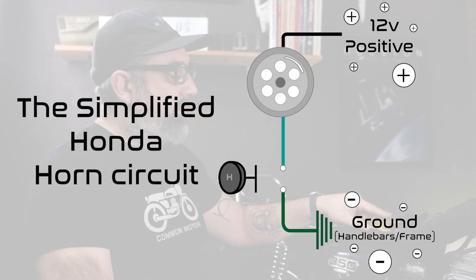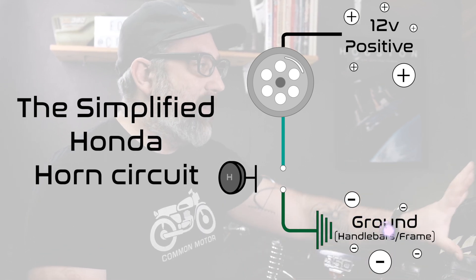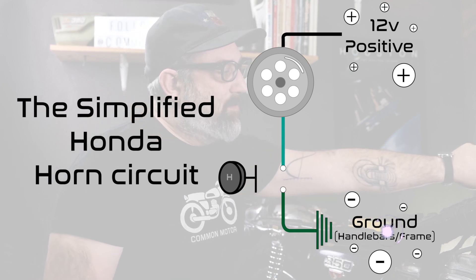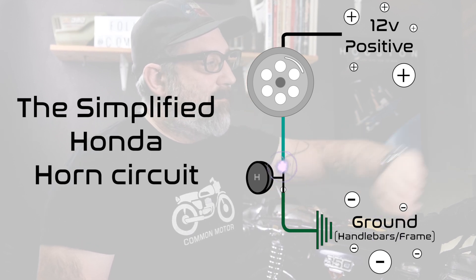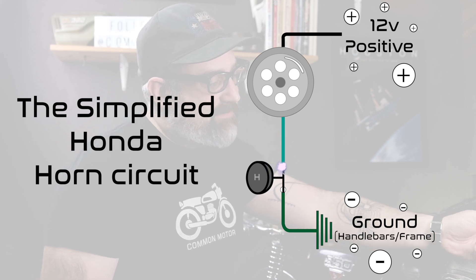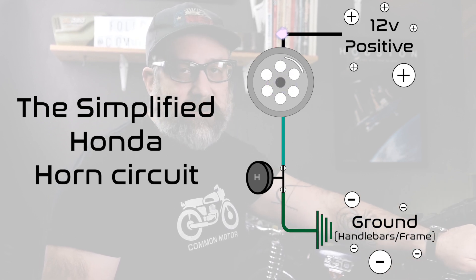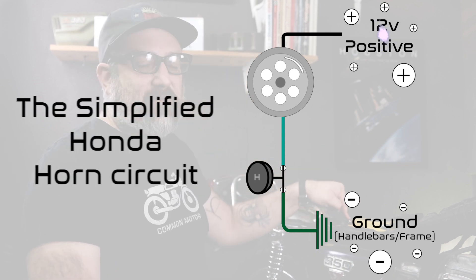So this is going to be the circuit for the horn going off with our charged battery. Negative is hooked to ground — ground is the motor, the frame, handlebars, all that stuff. When I hit this horn button here, I'm connecting the button to ground. Through the button runs the wire up the handlebars, it comes out right here as this light green wire which connects directly to the horn. Through the horn, back to solid black — and solid black is 12-volt positive — which goes all the way back to the positive terminal of the battery.